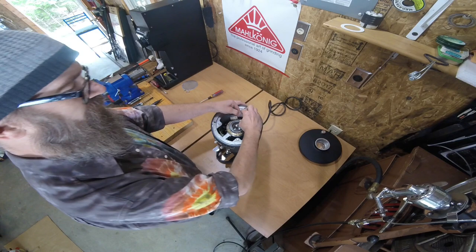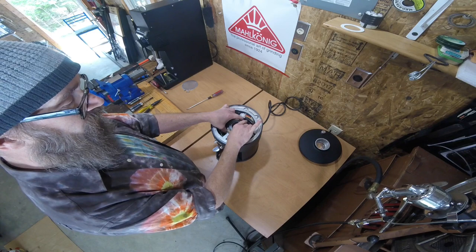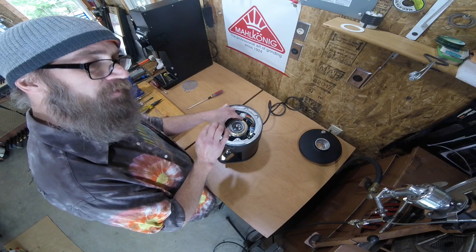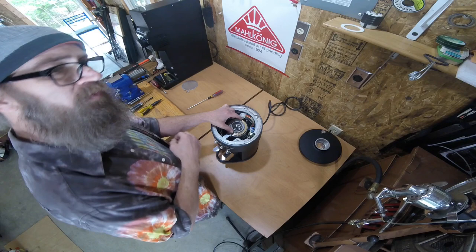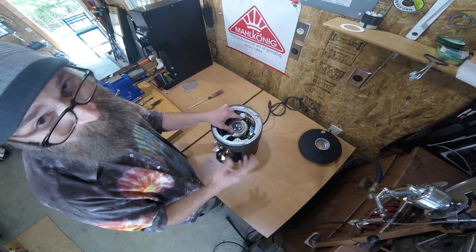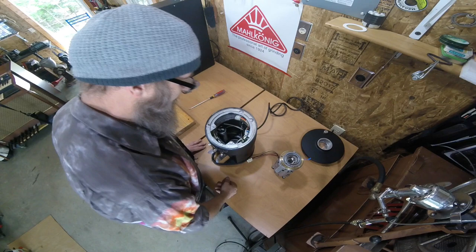I am going to disconnect the motor harness. You have to squeeze the two tabs and pull them apart — they're usually not that easy, especially if you've never done that before. They will be tight when they are fresh. On the K30 Air there is a grounding line that runs to the bottom of the motor and connects to the board that controls the fans. That board can't run unless everything's connected together. When you go to take it out, you need to remember to remove that wire — if you don't, it will pull on the board and probably break the small piece of plastic that is meant to be a tab holding it in. It'll still work fine either way, but it's always best to remember to remove the wire before you pull the motor straight up.